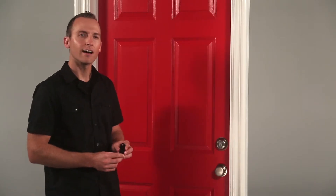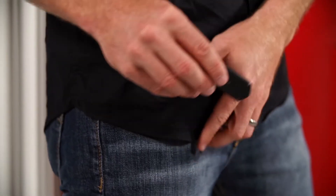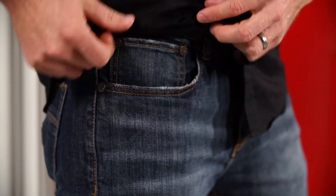The calibration process is timed, so let me tell you a few things first. When it's time to perform the calibration touch sequence, I'm going to put the fob in my front pocket. Through research and testing, we've found that this allows for the most flexibility in where you carry it during normal use. If you don't have a front pocket, you can calibrate while holding the fob in your hand, purse, or backpack, but you may be limited to holding it in the same general place during normal use.